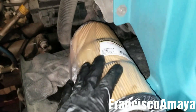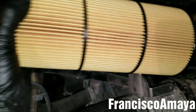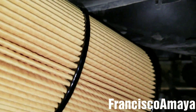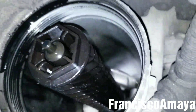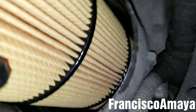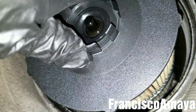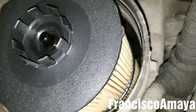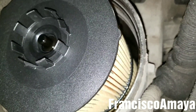To pre-fill the system, here is what you're going to do. I'm going to insert just the filter without the cap — the cap is right there. I'm going to insert the filter in here and take it all the way down until it clicks. Now it clicks — it doesn't move, it doesn't come out. You're going to leave it like that. It is all the way down. Don't install the cap yet.